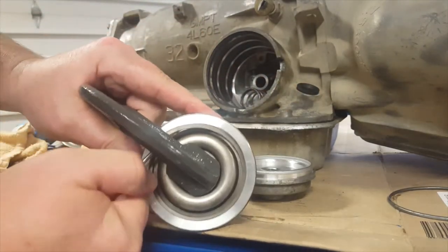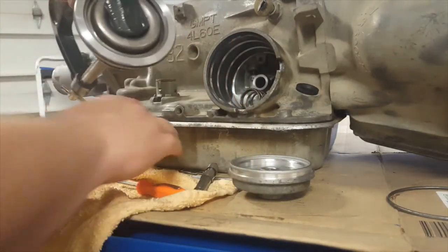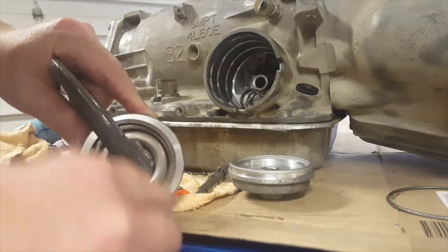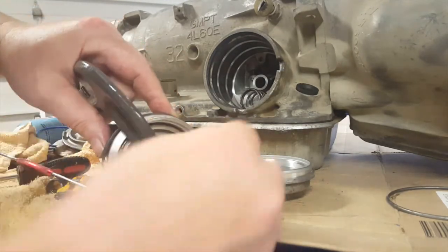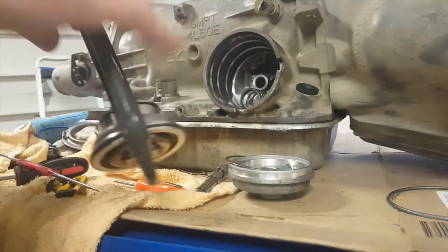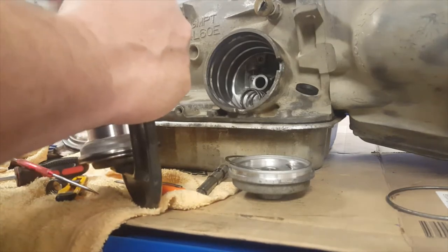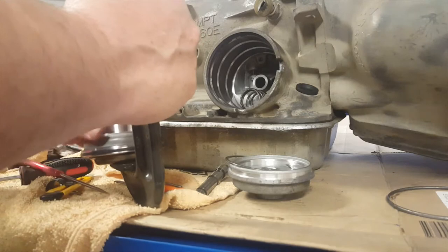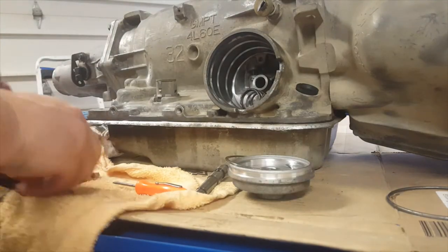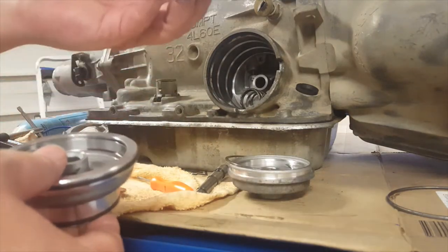All right. There we go. So, slowly, we'll get this out of here. I'd like to do it on camera without blocking everybody's view. I find it a little more difficult, but anyway, here we have it. Voila, one ring. Like I say, we need to retrieve the spring that's inside here. I believe they call it a cushion spring. I don't know, it's my first 4L60 transmission work I've ever done. I've never done a Corvette Servo before. So if you're new to this, so am I. All right, that's the part, and that's what we needed.